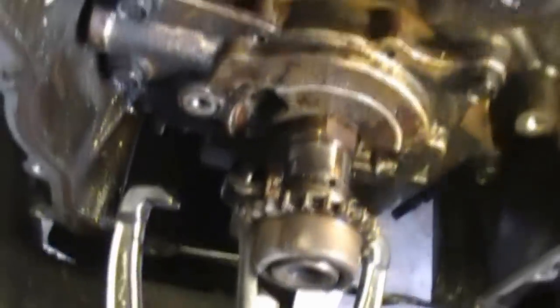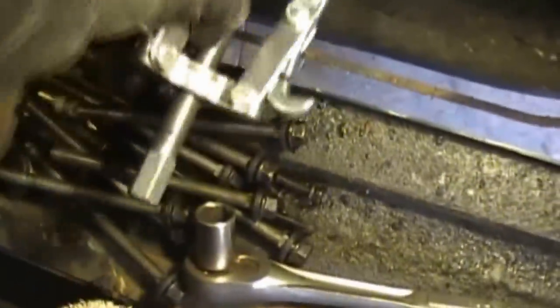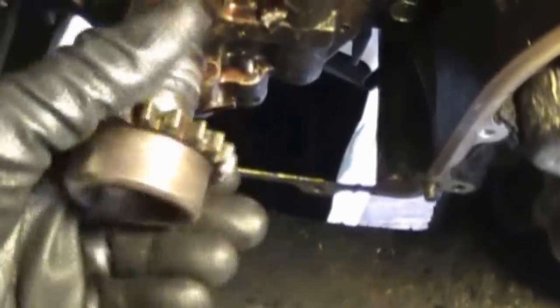I finally figured out how to get the gear off. You have to take a heating torch - I have a little propane torch. What I did was take a three-jaw puller - I kind of ground down the ends a little to get behind that gear. They do make a special tool you can buy or rent. If you can get the claws behind the gear, you can get that gear off. You can see it's off - it's still hot. That's how you get it off.